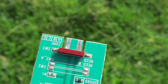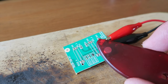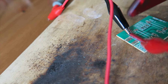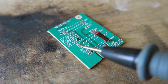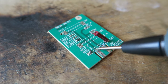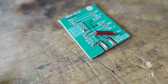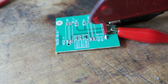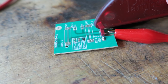Back at home now — I'm testing out the reed switch and can confirm it's not working at all. But connecting it straight to the reed switch, the meter is working no problem. I've lifted up the track and as I'm pointing out here, there is absolutely no track whatsoever — it seems to have corroded away quite badly. What I've done is just soldered in a piece of wire to bridge the gap, then placed the reed switch back over it and soldered it back in place. And here we go — all working. Let's get back in the car, head back over to the van, and try it out.